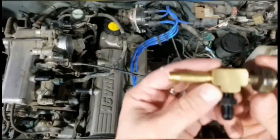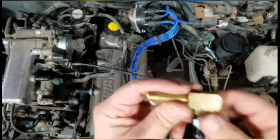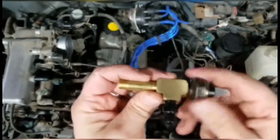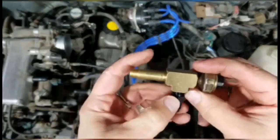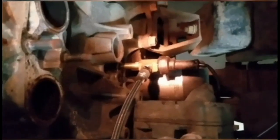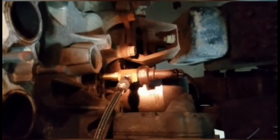So what I'm going to do is go into the block where the oil pressure sensor was, put a T-block in there, and then come off with the oil supply line. Essentially it'll be going right out of the block. I'm sure you can find a T that has a threaded end on it, but I want to get this done so this is the configuration I'm going with. It's got an inch and a half to the oil filter — should be good all the way around. I'll check for oil leaks later to make sure everything's copacetic.